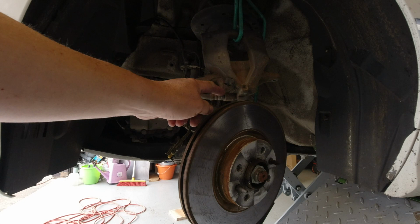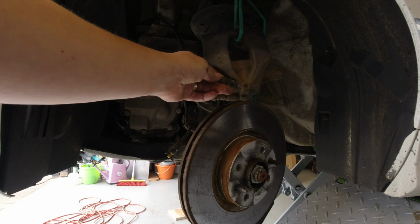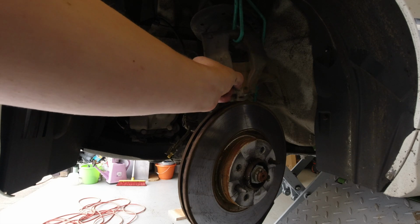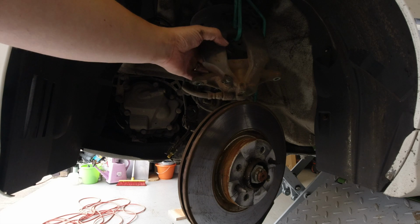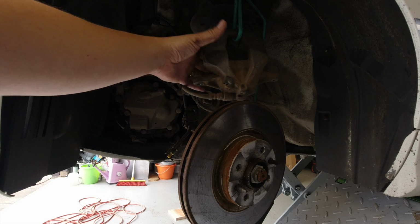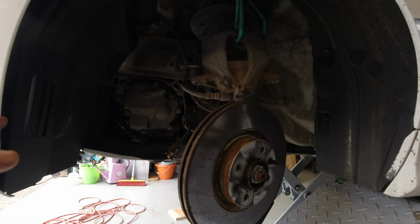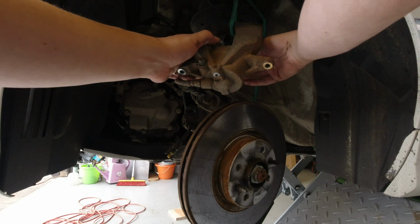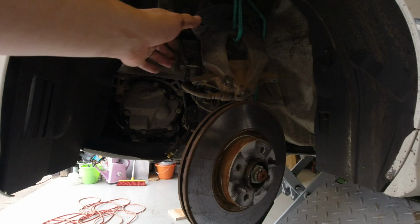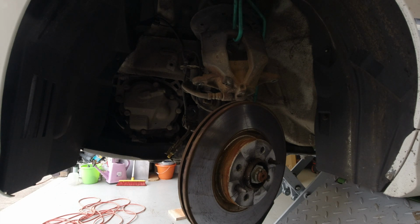What we want to do now is mask off the rubber hose, mask off the bleed nipple, and mask off the piston area, sort of drum in here that slides in and out. But other than that, I'm just going to put a big piece of bin liner or something else, cover up the wheel arch and the disc, and give that its spraying in situ as it is.